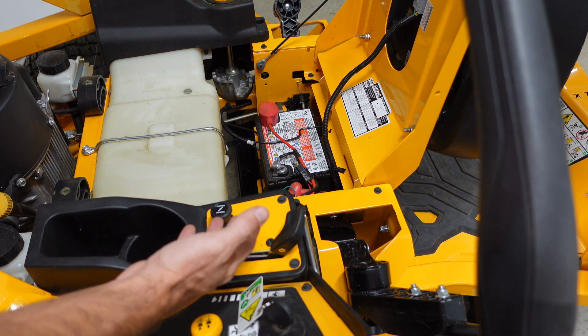Here's another safety switch. Your mower should start with this one unplugged, but if it gets unplugged you're not going to be able to turn your blades on. You also have under your seat different parts and part numbers. Another thing that can't hurt to check would be your spark plugs. We're going to have a spark plug right here and you can unplug them — you have one there and one over here. Make sure these are plugged in.